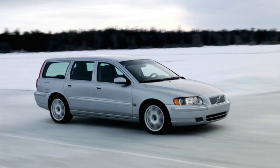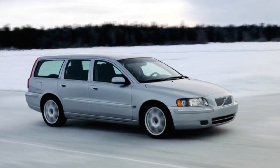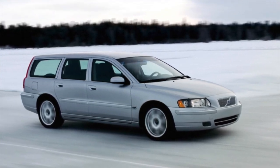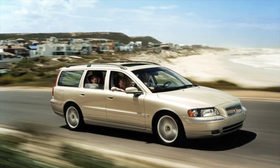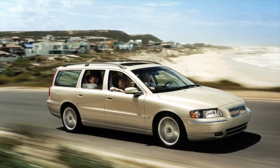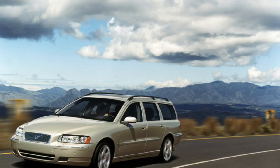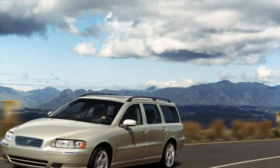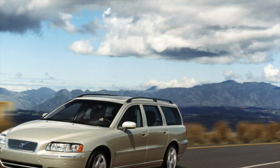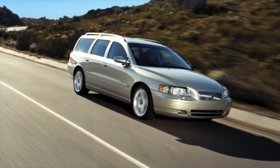The vast majority of S70s are front-wheel drive, but in theory there are options with all-wheel drive through a viscous coupling. Technically they differ little from the later all-wheel drive cars of the brand. Until 2003, these transmission elements were used on the V70XC and all-wheel drive S80, and even after the angular gearbox of the 5-speed automatic machines and the 6-speed manual gearboxes, it remained almost unchanged, maintaining compatibility.